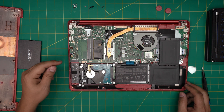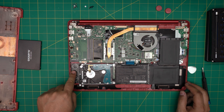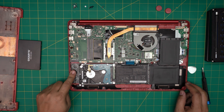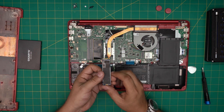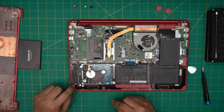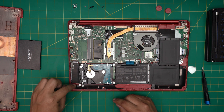Inside you'll see the mechanical hard drive. This laptop also has an M.2 SSD slot — it takes the M and B key type, not M key alone, so you need to get an M+B key SSD. They look something like this — you slide the drive right into the slot and secure it with a small screw. I'll leave a link for the screw in the description.